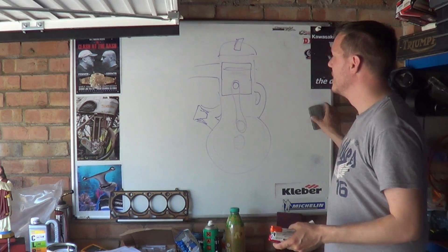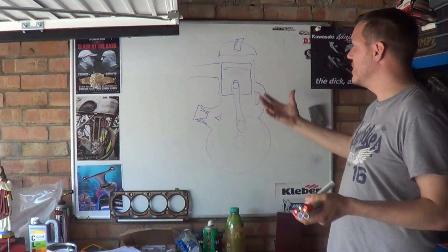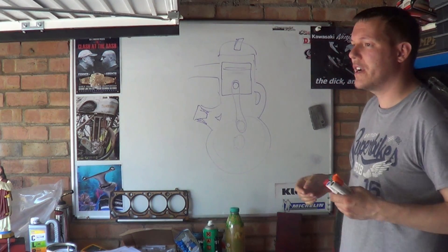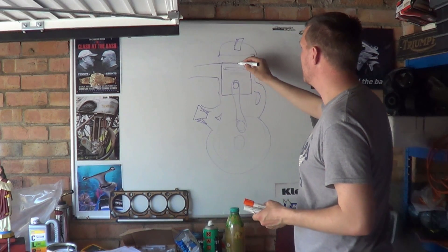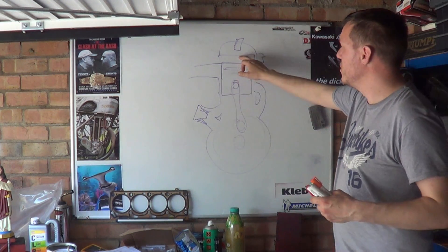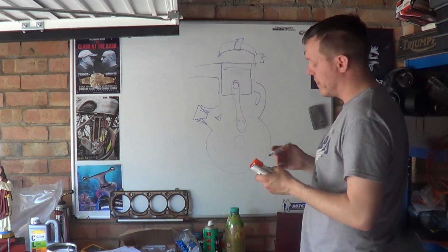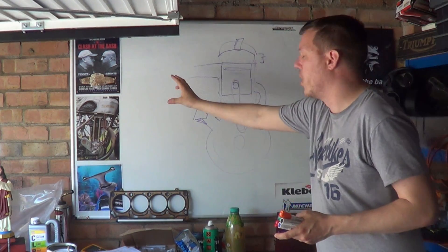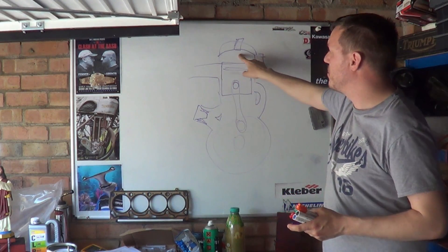It's a motorbike channel. People ask why this is so hard to do. I explained before in a previous video that the pressures required to do direct injection means that your piston has to close off your exhaust port, which means that this volume in here, including your cap and your combustion volume, is already at one or two bar - because hopefully your exhaust is tuned properly and it's pushed a bit more back in there.